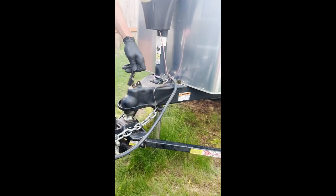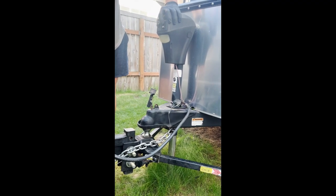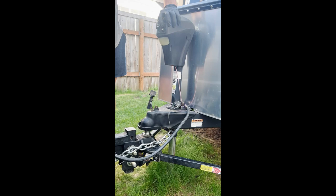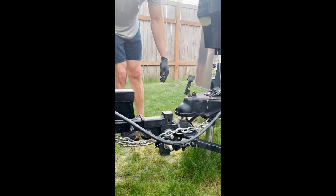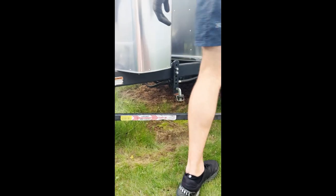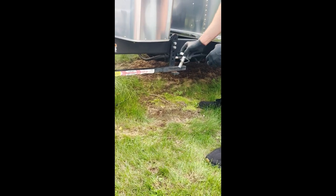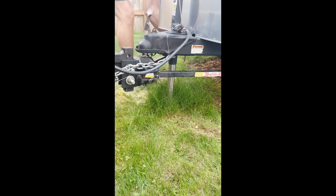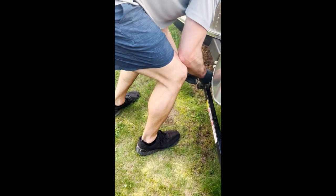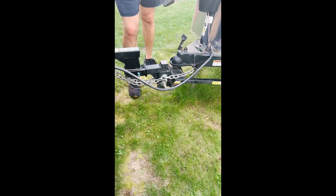Make sure that this is pulled up so that it can sit properly. Before you start to put too much pressure on the hitch, let's put our sway bars in. To put your sway bar in, you're going to remove this pin by lifting up. The sway bar comes over here, over the top, and this pin sits like that, and then that goes down like that. Same thing on the other side. You want to wait until it's on the hitch for the sway bars, otherwise they're really hard to pull up and get on.